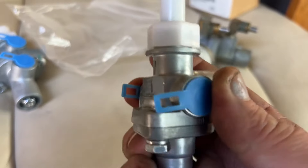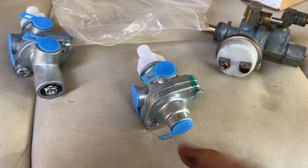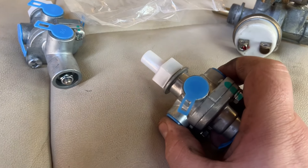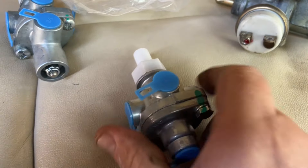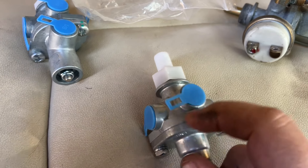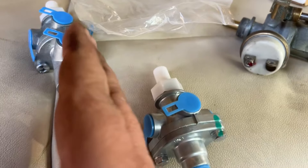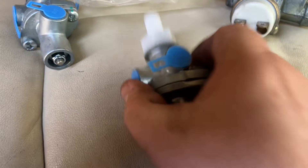This is called a PP1 valve — this is what all spring brake vehicles use. There are three ports on it, well technically four. One's an exhaust where the air comes out at the bottom. Another is the supply — the air pressure coming in — and then two are used for delivery. The delivery goes to the brake cans themselves, or sometimes to a gauge to let you know the parking brake isn't on anymore. When you release the parking brake, it sends air pressure into the can, which pushes the spring back and holds the brakes off. When you park, you turn it off, that air discharges out the bottom, and the springs hold the brakes in place. That's how all spring brakes work.